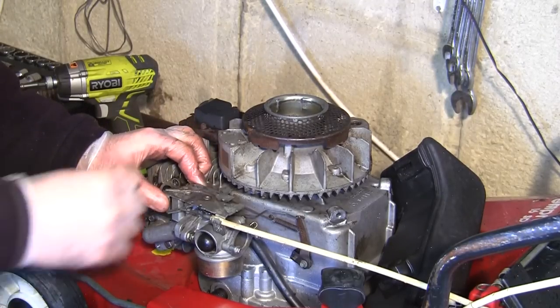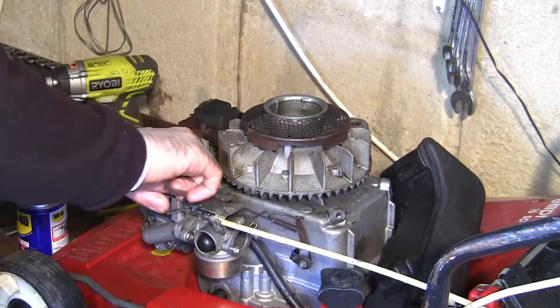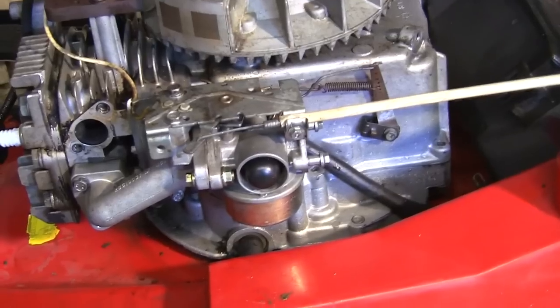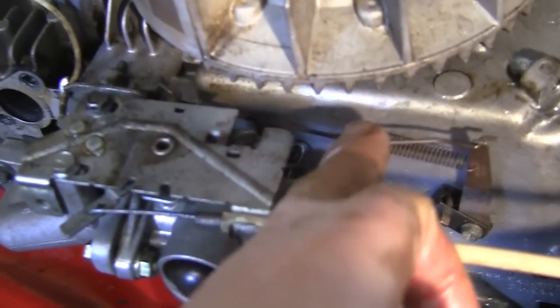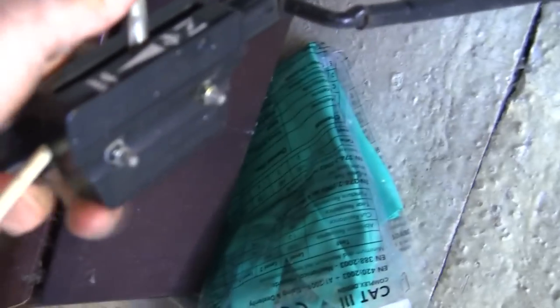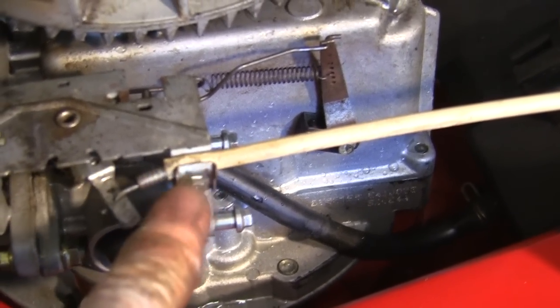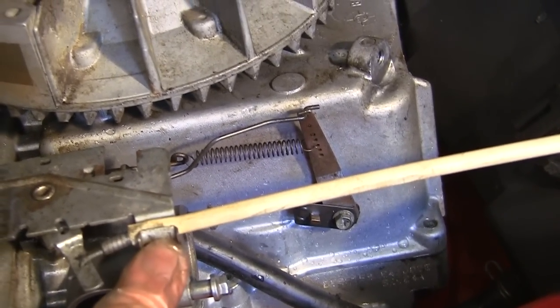You'll probably see there, I've just put a little bit of WD-40 down the hole there, and what I'll find is the thread normally just sits in nice like that, and you can actually get this whole thing threaded, and I can bolt this all back on. So what you need to do when you put this back together is you need to make sure that these arms move freely, like I've just shown. You need to make sure that this throttle works as well. You can see how this lever's pointing over this side. If I actually go up here, push that up to the top, even with these old cables, you'll see this is all moving here, and you can set this. You could actually get a bit of adjustment by undoing this little screw under here and moving this backwards and forwards. It was running quite fast before.